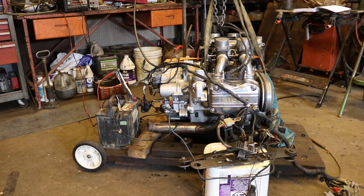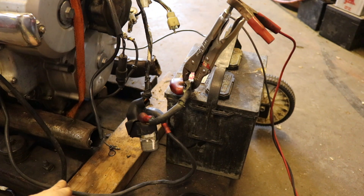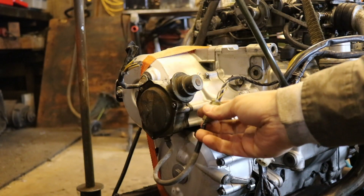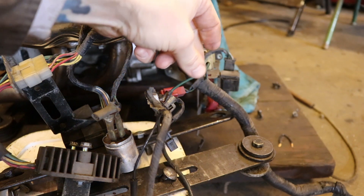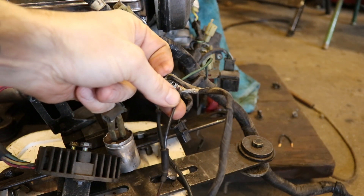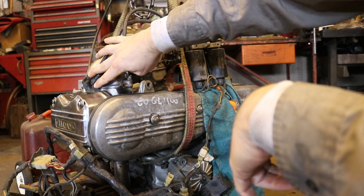In order to run this thing, we've got a number of contraptions going on with the wiring harness. I've got the original wiring harness on there, hooked up to the battery the way it normally would be. The battery is connected to the main fuse and the solenoid, then the relay connects to the starter. I've also got the pickup coil plugged back into the wiring harness, and the battery grounded to the engine. There's a ground wire that grounds a number of things in the harness, and the neutral switch also grounds out. Then we've got the ignition coils plugged into the wiring harness, and off of those come the spark plug wires connected to the spark plugs.